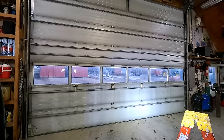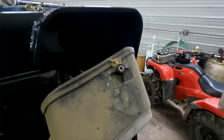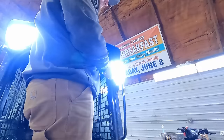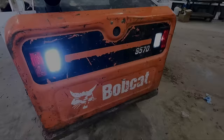Getting an in-cab look at the difference between the two lights — wow, you can't even see the left side. Let's keep moving and do the other side. To take the old one out you got a 10 millimeter here and a 10 millimeter on top. Give it a nice wiggle — popping right out. Take the weather strip off. And there we are — new lights are installed. Let's turn all of them on and get a good look at them.